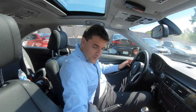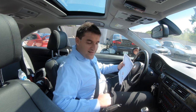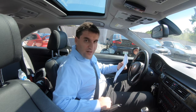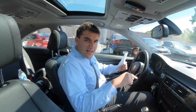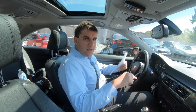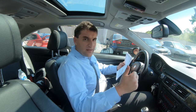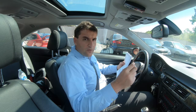What's up guys? Welcome to GoGoMotor YouTube channel. We just finished doing the dyno test of my 2007 BMW 328i following the installation of the three-stage intake manifold and the AA headers to determine what the effect was of doing that mod. As you may recall, I dyno tested this exact same car on the exact same dyno machine before I did the mod. And what I got was 199.9 horsepower at the wheels and 188.2 pound-foot of torque at the wheels.